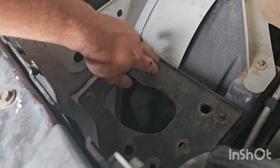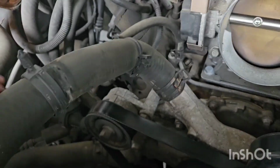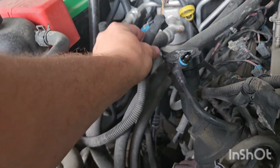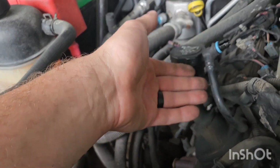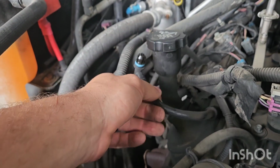And just let it run. It helps. So it's all empty now. Make sure you look. Ain't got no acorns, nothing like that. Everything looks crisp and clear. Put your mass airflow sensor somewhere you can easily get to it. Remember where you get to it, as well as your, I guess it's the vent breather, whichever.